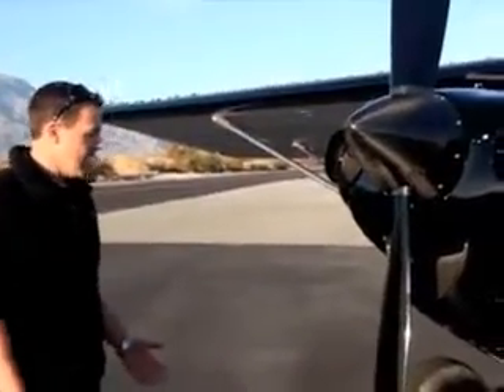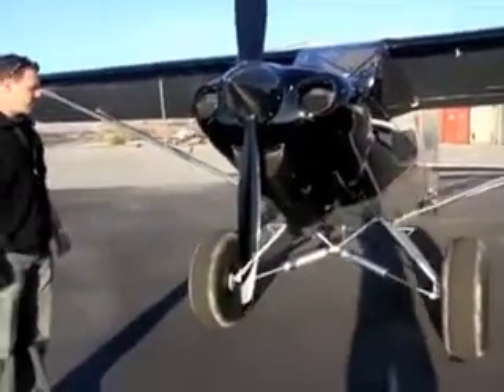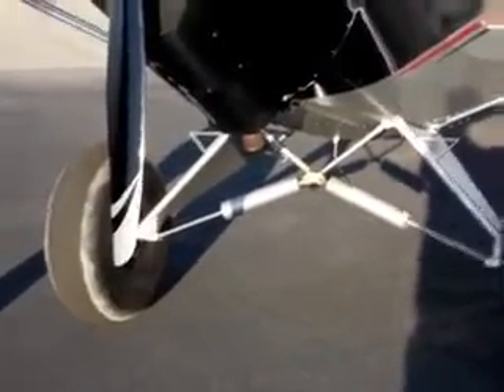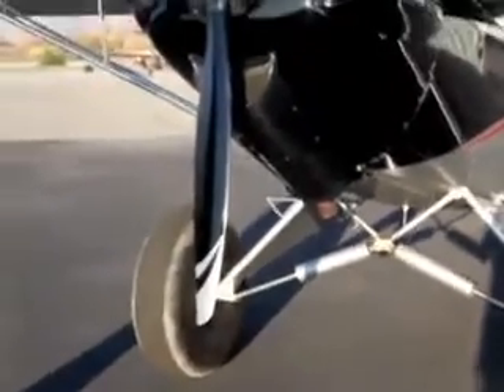Continuing the walk around, the landing gear looks different than the typical old Cub. This is an AOSS landing gear redesigned for our lightweight aircraft. It offers low speed compression and rebound dampening, which doesn't get offered by bungees or even the hydrosorbs that the original Super Cubs had. It's really good for the off-airport environment — you can plant the thing and it won't bounce on you.